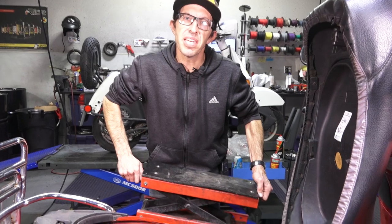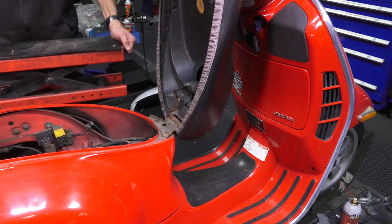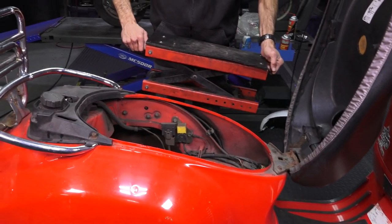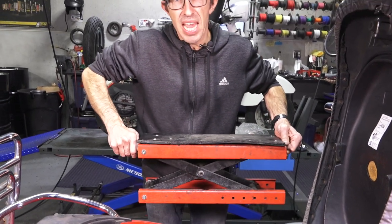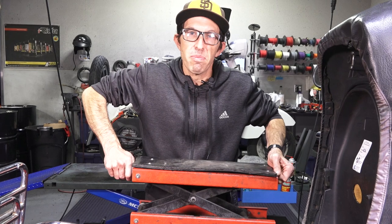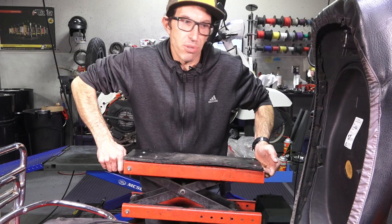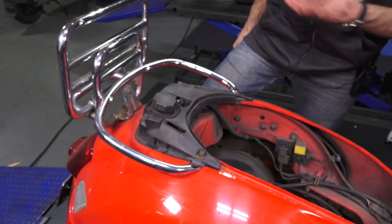I'm going to go quick because this is for the professional or home mechanic pretty accustomed to working on scooters. First, you'll need the scooter on a lift or some means to clamp the front tire — even wood or someone holding the bike works. Then you're going to lift the center of the frame and support it when you partly drop the motor. I typically use a scissor jack specific for a motorcycle, though an automotive jack will do the trick.